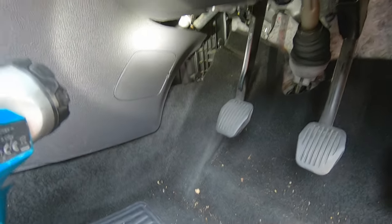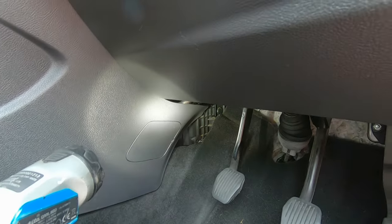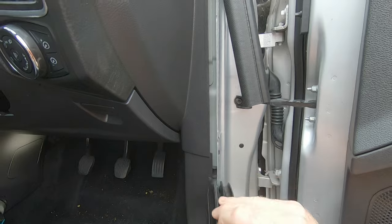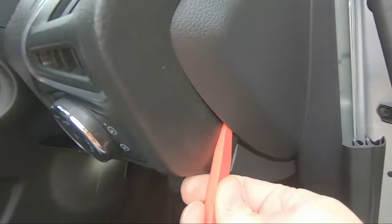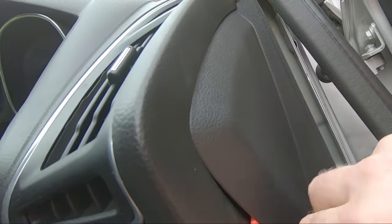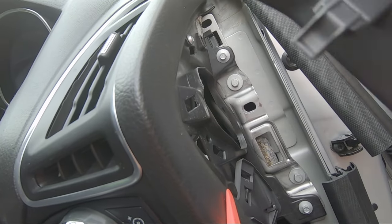Long story short, I felt the carpet here in the corner and it was soaking wet - you could see dribbles of coolant running down. The easiest way to check is the carpet will be wet in some places, and quite often this drips from here down. The first thing you've got to do is get access to it, and that means getting this panel off here. To do that you have to take two or three panels off first. You've got to lift up your trim on the side of the door and lift this part down, pop in the side just to get an edge under it. This panel comes away to the side, rolls around to the right, and the whole panel comes away.